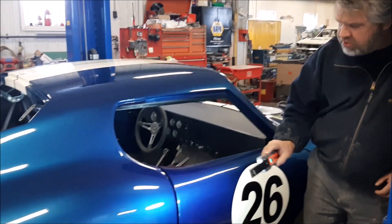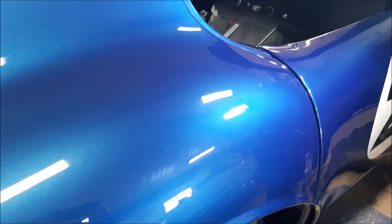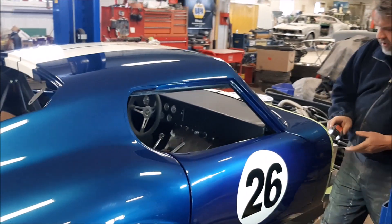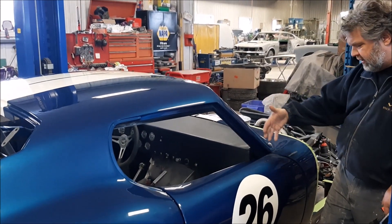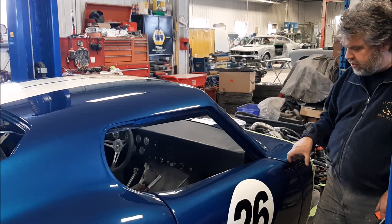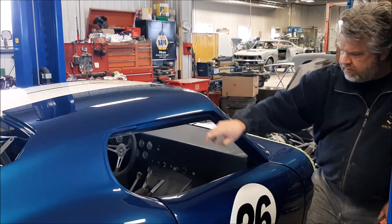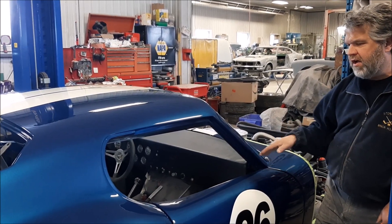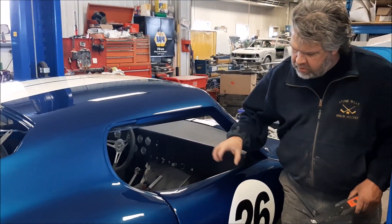With all the hardware, when they went to dry fit everything, they gave all of the metal work to me and we media blasted it all — sandblasted it. Then we powder coated all of the internal items instead of just using a spray bomb, so we've got it all powder coated black. We did the same thing with the frame. We had to modify the window frame, and after it was all modified, trimmed, and filed, we sandblasted it and I've also powder coated that, which we'll share later on. So quite a bit of progress on it.